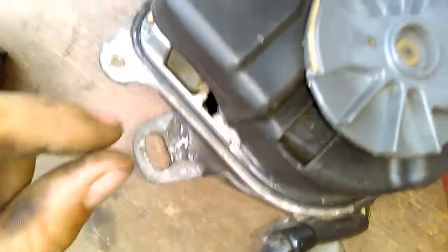The seal is right there on this one. But we got a bolt busted off in this, so what we're trying to do is extract it. We're gonna drill it and extract it - hopefully it'll work. I'll get back to you if it does.